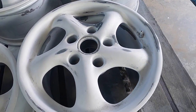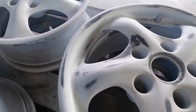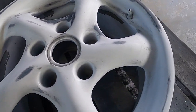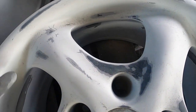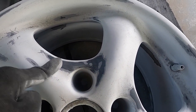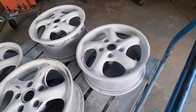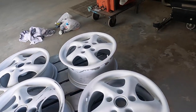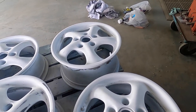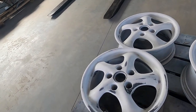After about two hours of sanding, this one is finally smooth. This is the one we originally sprayed a full coat of 2K clear on. There's still a little bit of bumpiness but this is probably as good as we can get it. It had to go down to the black, but it should be good. I have definitely learned my lesson — I will not put 2K clear on anything ever again.